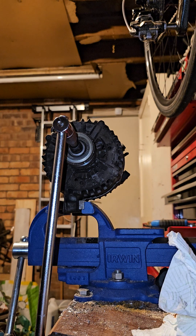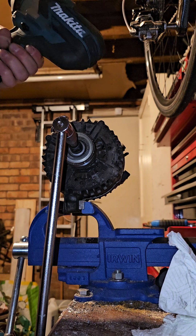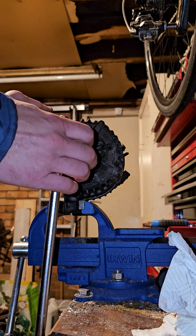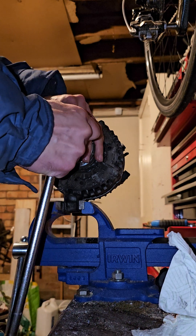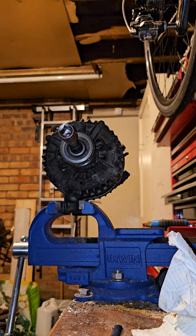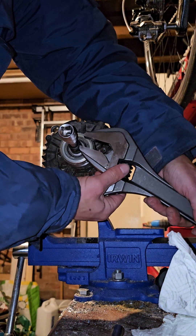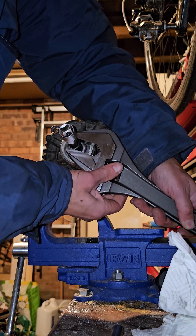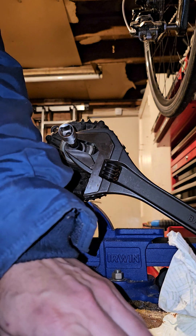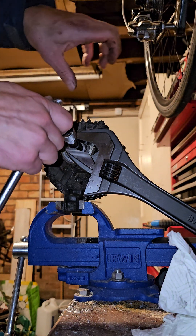So I had to resort to the Beast — the Makita impact wrench with a 1400 Nm torque rating that will undo anything, or it rips the bolt off. This time I'm doing the reverse: I'm going to hold the 33-tooth spline section — the pulley — rigid, and then turn the driveshaft clockwise. If you think about it, that's the same as loosening the pulley anti-clockwise.